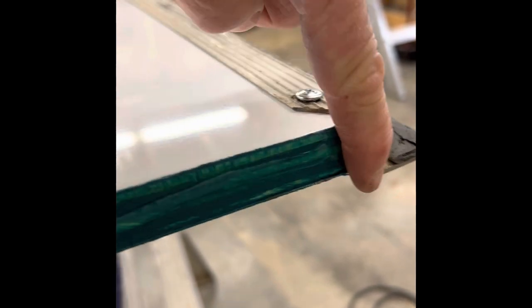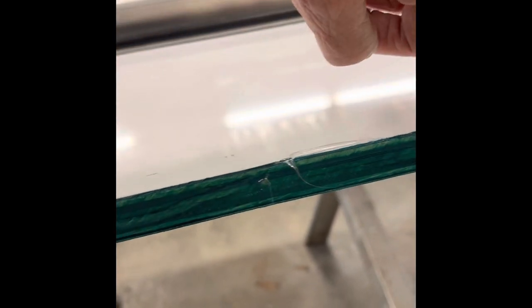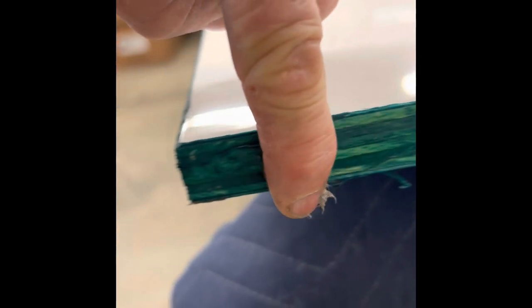You can see the bead of silicone I've applied about midway down through there, and I take my finger and spread it. Last time I put a bead and trusted that the channel on the first door would spread it — which it will — but I put too much and it oozed out beyond the flanges, creating a mess. So I'm controlling that mess with this method.